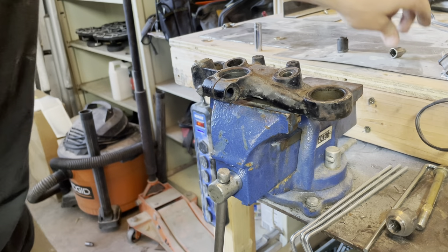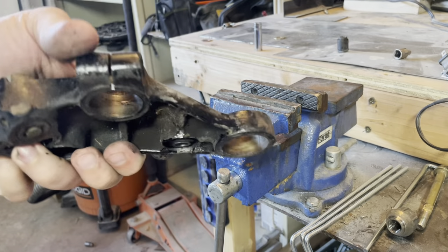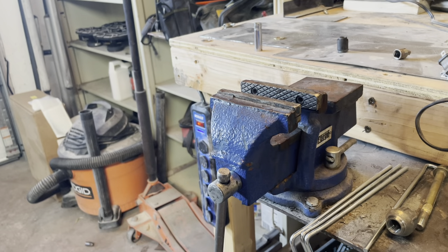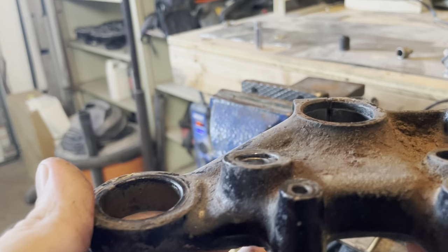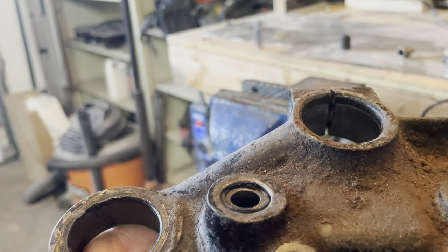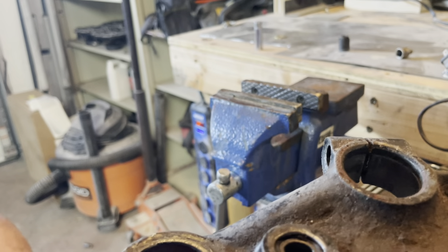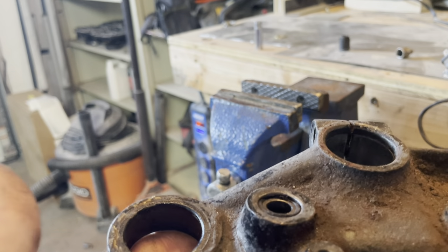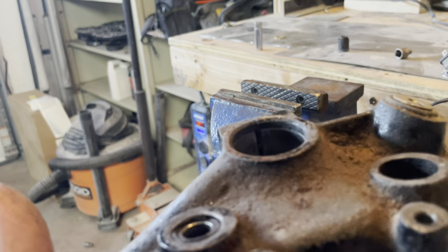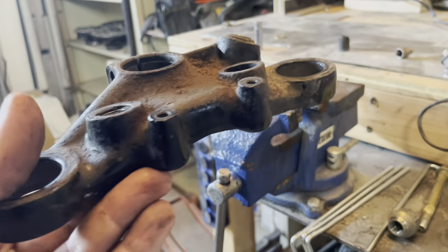As you can see, this isn't nearly as fast as the press, so I may cut some of this out, but it is falling down. The inner part of the bushing and the outer part of the bushing are starting to separate, and that's falling down further. I'm going to hammer on this for a while — I may fast-forward or cut it out — but I think it is possible to do it this way without a press and without buying a tool or waiting for it in the mail.